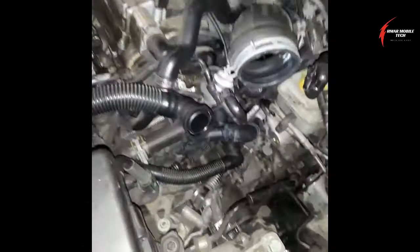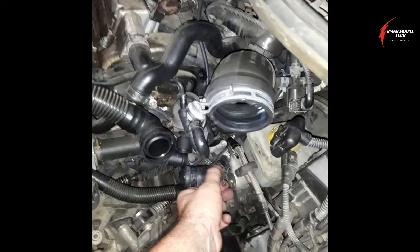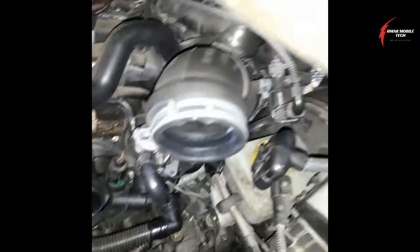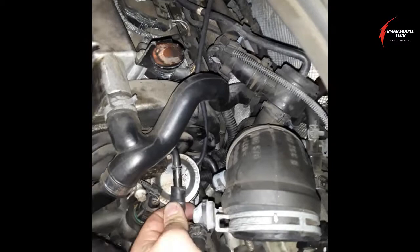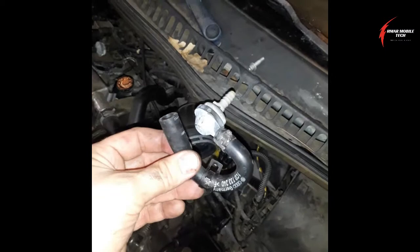Back up top, there's a hose that connects to this bypass coolant valve. Pinch the hose clamp with your slip joint pliers, pull it back, and move it out of the way. Make sure you have a catch pan to catch the coolant and throw a couple sheets of cardboard down — that really helps. I found it was a good idea to also take this little check valve out, using hose clamp pliers since it's really difficult. If you have an old Volkswagen, Passat, or Jetta with a similar engine, you need to get these things out of the way.